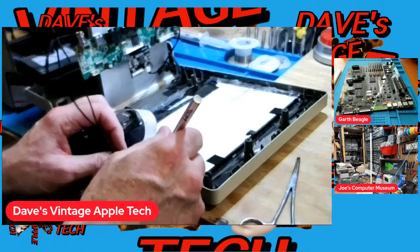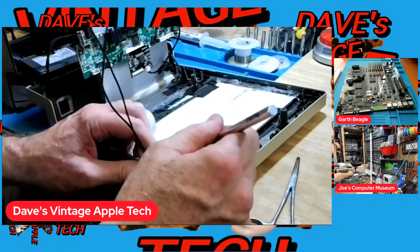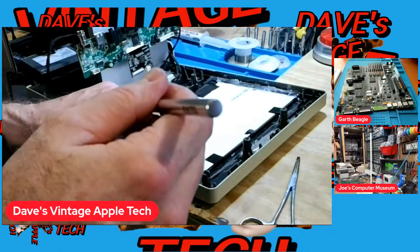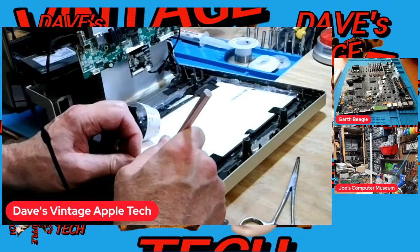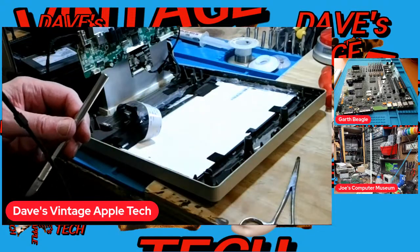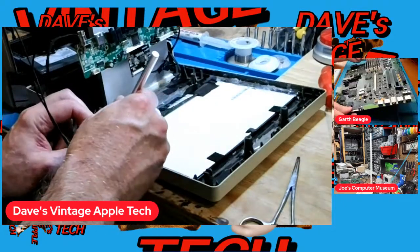He shipped me three boards. The second board just had a bad CPU. Go figure. It's right here. Bad CPU. And he shipped me a third board that is a black screen. My diagnosis on that board is, after having removed and replaced just about every chip on the board, it's either bad slow RAM or a bad FPI chip.